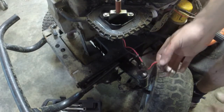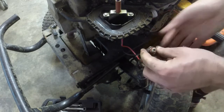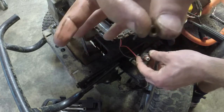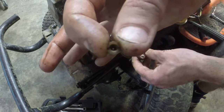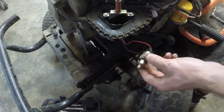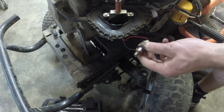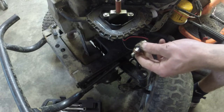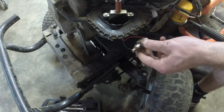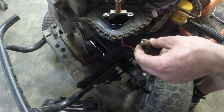Alright, let me show you what I have done. I sprayed some lubricant down there. I took the main jet out just with a screwdriver. The main jet looks really good. The main jet's clear. I don't know if y'all can see a hole through it. There you can, right there. Looks very clear. Even the gas in the carburetor seemed like it was decent. And I just worked some carb cleaner and lubricant down into it and pressed it down with the little rod, and we're working now.